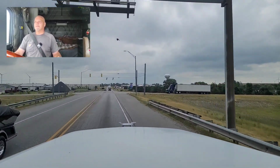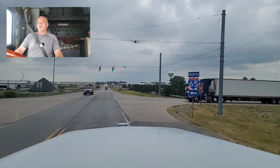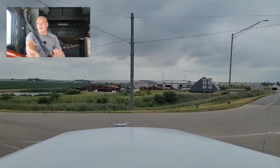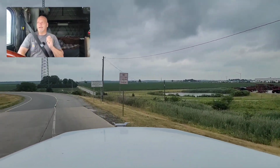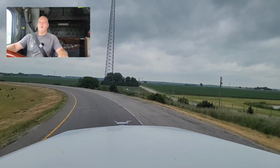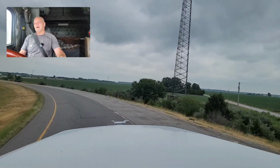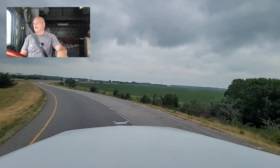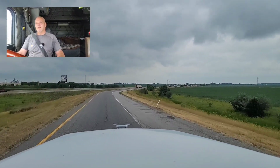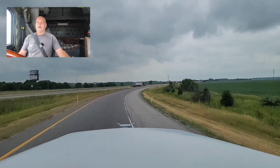On a 13 speed, you don't even really have to take the stick out of gear and put it back in gear. All you really have to do is flip that button forward, let off the accelerator. But I am so used to moving the stick out of gear and then moving it back into gear, it messes me up. That, and not to mention it has been 4 years since I drove a truck without. So move a button forward, come out, right back in, move a button back, move a stick back, move a button forward, stick forward, right back in. I get the hang of it.